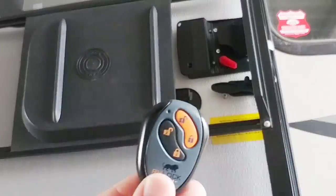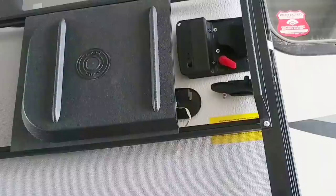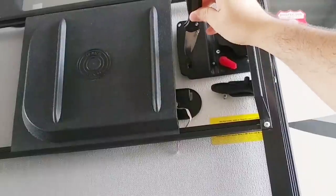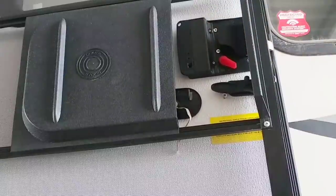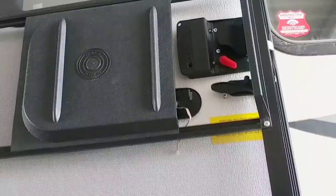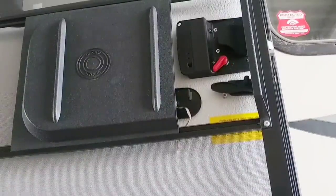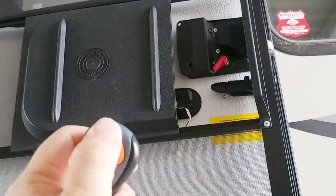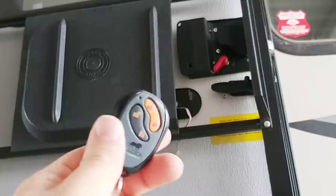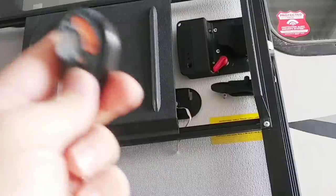To program the keypad, go to the back or inside portion of the handle, flip the switch to the on position by flipping it up. Then press the fob learn button right above it. You'll hear a short quick beep confirming it's entered programming mode. Press lock, you'll hear a long tone, then press the unlock button — and as you can see, it works. At this point, all you have to do is press lock or unlock. And if you turn that switch off, it turns off the ability to use the remotes, which is nice in case you've lost or misplaced a remote.